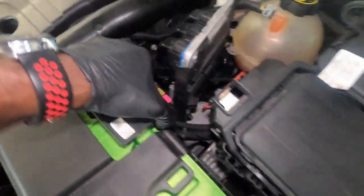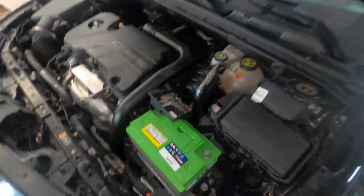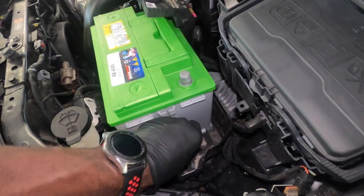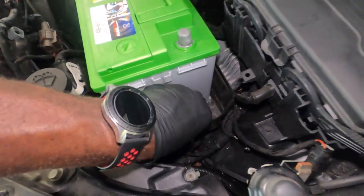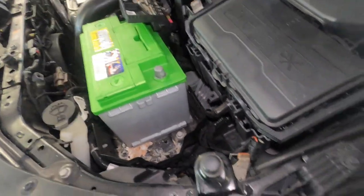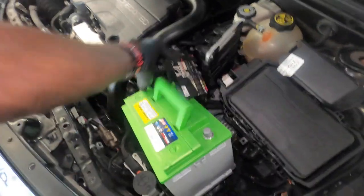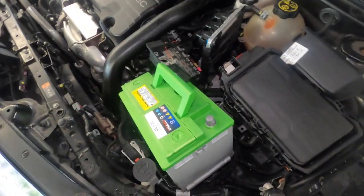Then remove this 10 millimeter right here from your positive. Take that off and lift up on this cover, the battery heat shield or cover, whichever way you want to call it. Right here is your battery holder. This is 13 millimeter. Link will be in the description for all the tools you need. So 13 millimeter and 10 millimeter so far. Go ahead and lift your battery out. So now your battery is out.